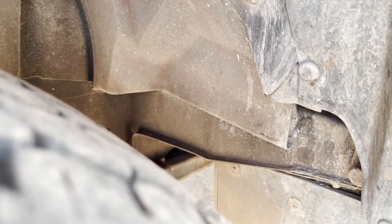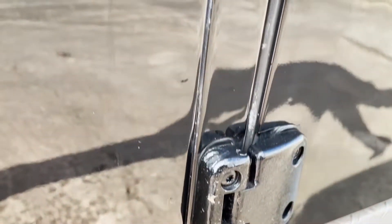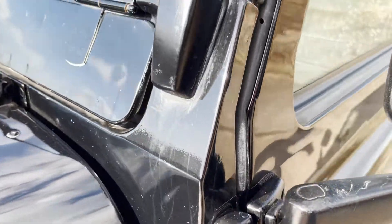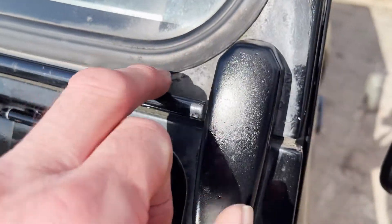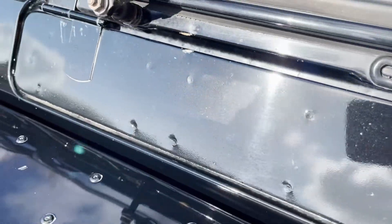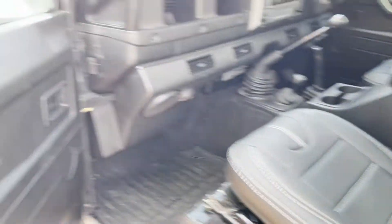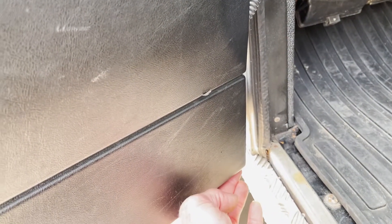Land Rovers always pick these up down the sides because they're so soft — it's only aluminium. Let's have a look under here. Can't see a massive amount with the big tyres on but that's the front nearside outrigger and stuff. There's a bit of paint loss around the windscreen frame in the usual area, but the screen block doesn't seem to have lost too much of its paint — it is a bit stained under here, very common with the black ones. The screen itself is in pretty good shape with no big chips. No sunroof on this one, which is good. The nearside door from the outside looks pretty good. Being an 03 plate this has got the earlier type of doors — there's a very slight bit of crumbling just here at the very front but the rest of it feels good and strong on the hinge supports.